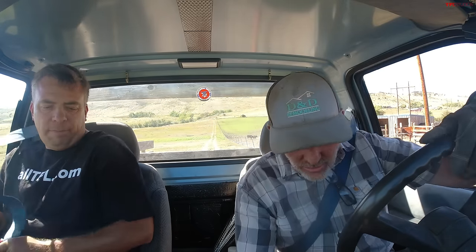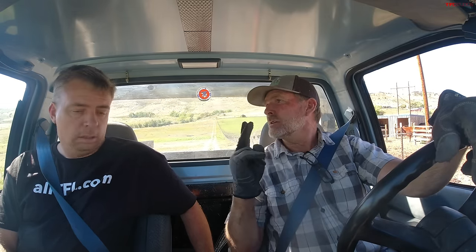What I want to show you, that's what I love about this truck. I'm going to go four wheel low. From 92 to 94 is the only years they put a crawler first gear in this five-speed transmission, 6.34 to one. For two years, Dodge didn't have it, Ford didn't have it, GM had it in the NV4500. So you can just put it in crawler gear.